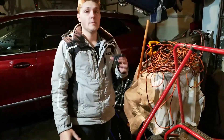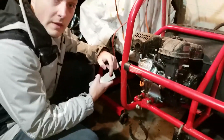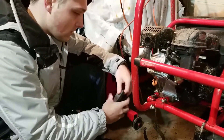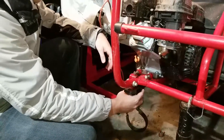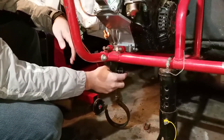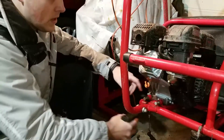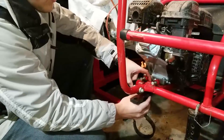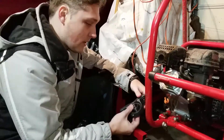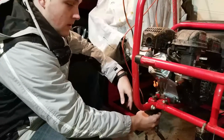We looked at this and we're going to have to do something I don't want to do. We mounted the motor up, and the main issue is that if we run a bolt for the bearing on the underside here, it's going to majorly conflict with the bottom half of the engine. We're obviously not going to notch the engine because there are oil passageways in there. We were hoping the bolt hole would be forward a bit, but it would basically be directly under the engine, and I don't feel comfortable making a captive bolt underneath there — I don't think the weld will hold. So what we're thinking is running one bolt right through the plate and through the tube, and another one on the back on the roll cage. It's not ideal, but we have no other options, and we can easily mirror it on the other side. We'll go ahead with that, properly shimming it.